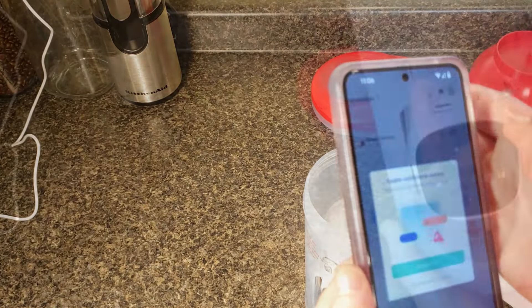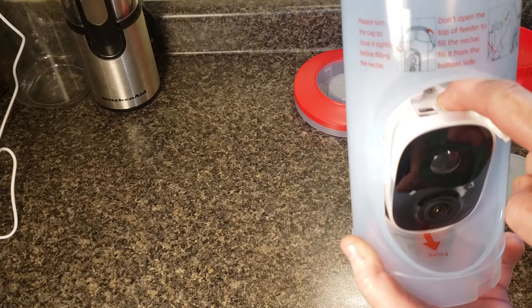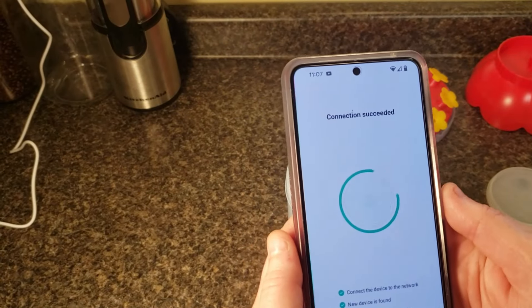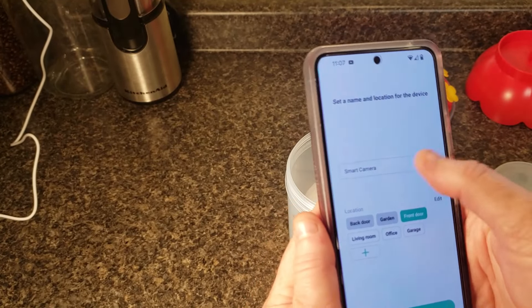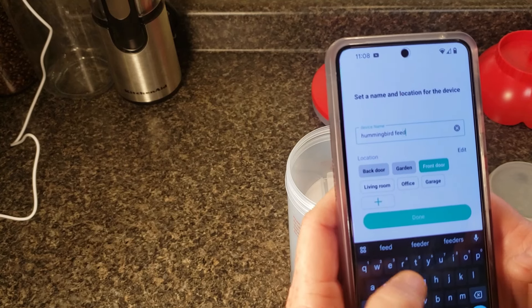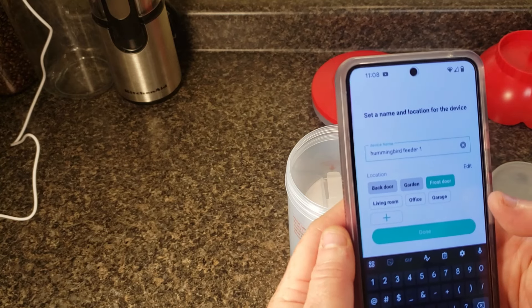On the top of the camera there's a power button, so you want to hold that power button for three seconds and the camera will come on — you'll hear a loud tone when the camera comes on. There's also an SD card slot on the camera if you want to save your footage to an SD card. The app will then take you through the setup process, and it will have you take a pic of a QR code on your phone with the camera feeder to complete the connection. A 2.4 gigahertz Wi-Fi network is needed to connect, and you also want to make sure you choose a location that has good Wi-Fi signal — you can see the signal strength on the app.